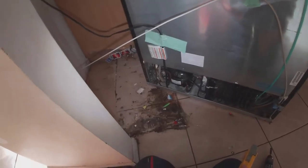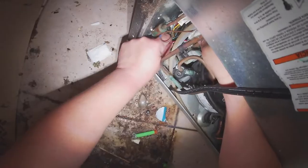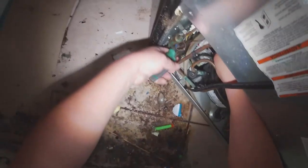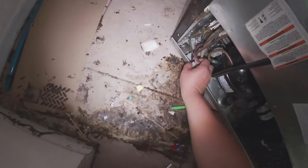When I got to the house — five kids — I asked the lady for a broom and a mop to clean back there, and she went to her room and never came out. I'm going to start removing the harness from the relay. I always recommend disconnecting the appliance to work with no power. As you can hear, while I was working the compressor came on, so I let it run a bit. You heard that click — that means the compressor turned off again. It only comes on for a couple seconds and then turns off. Now we remove the harness to check if we're getting voltage. This is the harness that goes to the compressor relay.